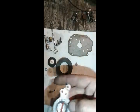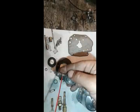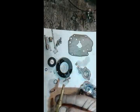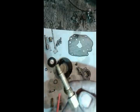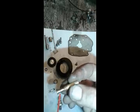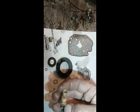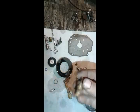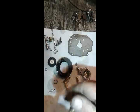Same with these passages. Inspect the jet visually — make sure all these holes are clean, and of course the jet itself. Same with the idle jet: there are a couple of holes on the side, so blow through it if you need to clean the inside. Our seat is nice and clean as well — I like to use a little bit of carburetor cleaner on here as well.